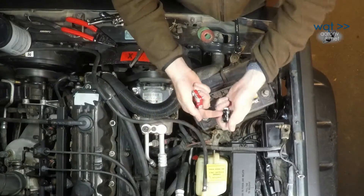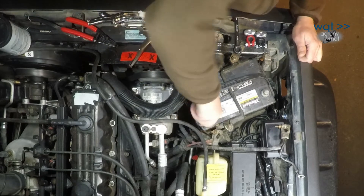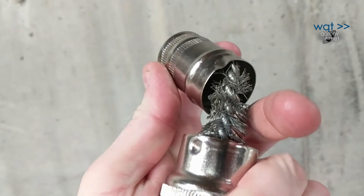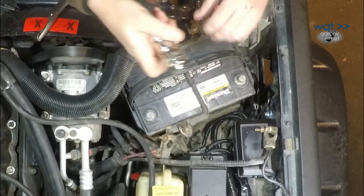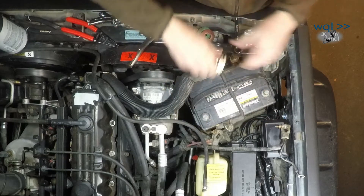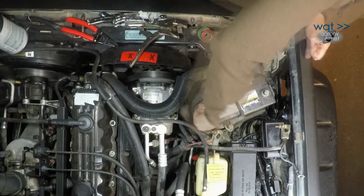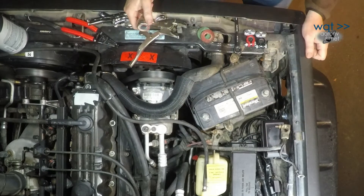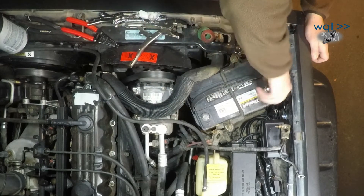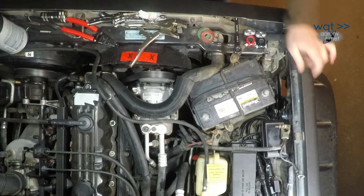What I'm going to use tonight is a set of replacement battery terminals with compression connectors. Step one is to clean the terminals as best I can using this device — a multi-purpose battery terminal cleaner. It has wire bristles on the inside, and a wire bristle brush on the end to clean inside connections. You can buy these for a couple bucks. It cleans the layer of surface corrosion off and leaves a nice fresh bare metal surface for the terminals to connect onto.